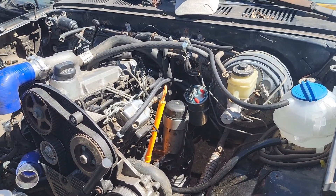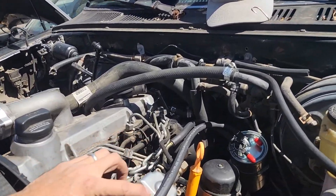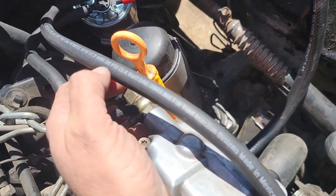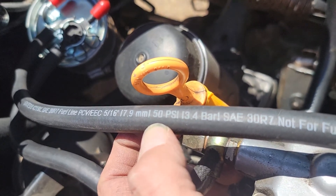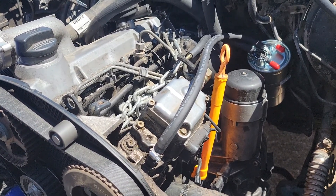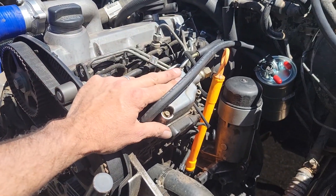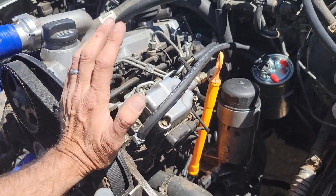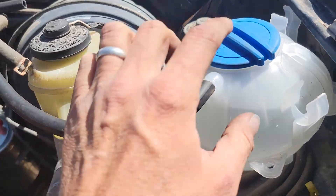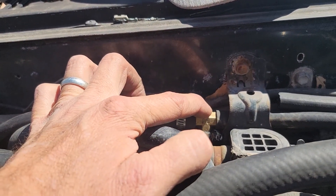As far as hoses go, there's nothing really fancy. They might say 7mm, 5mm, or 14mm hoses for this pump, but this is five-sixteenths non-fuel-injection hose. I like to get non-fuel-injection because even though it's non-fuel-injection, it's still rated for 50 psi. The most you're going to run is about 17 psi if you run a lift pump, but I don't generally run a lift pump because I don't try to run over 150 or 180 horses. This engine sucks so hard you don't need a lift pump. Your five-sixteenths hoses are also the same size as on your coolant bulb.